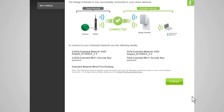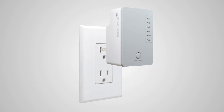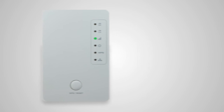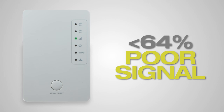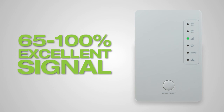If your settings are correct, you will see a summary of your connection details. Congratulations — you are now ready to use your extended network! If you haven't already positioned your range extender in an optimal location, you may do so now. All range extender settings are saved and you can safely unplug the unit to explore the best location. The range extender has a built-in signal strength LED on the front. When the LED is solid green, the signal strength is 65% or greater, which is most recommended. If the LED is blinking green, the signal strength is 64% or below. When there is no LED, the range extender has no connection to the router at all. Find a location where the signal strength LED is solid green for best performance.